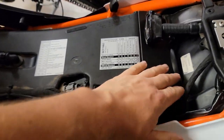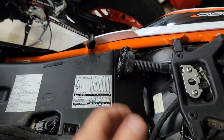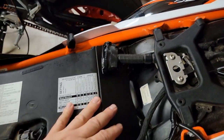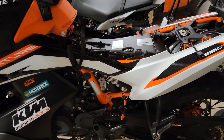So as you can see, no reason to have your dealer do this. It's two screws. This pulls off. You pull up the back piece. The air filter pulls out. You change the frame to the new housing. After you wipe everything out, get it nice and clean. Put a little bead of grease around your air filter. Put it back together. Screws in. Seat on. Document when you did it. That's all there is to it.